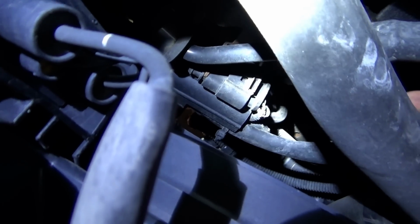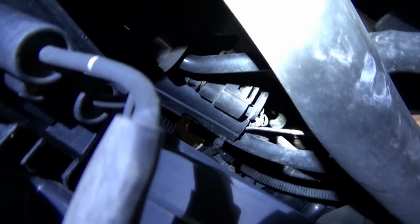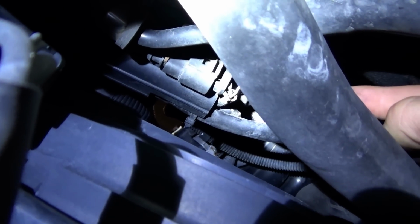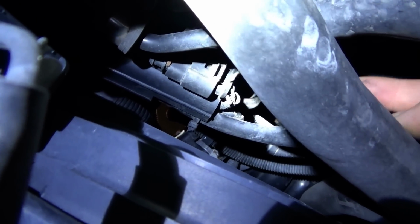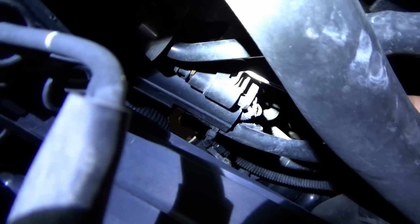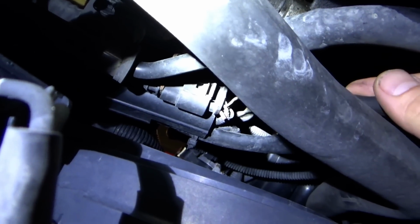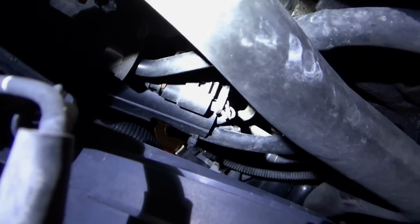So we need to get this thing apart. Like they said, the wiring is tight. That's why it kind of does this. And we can even check the resistance from here through the N280 valve and back. Make sure that's all good. Repair this wire and make sure the AC works.